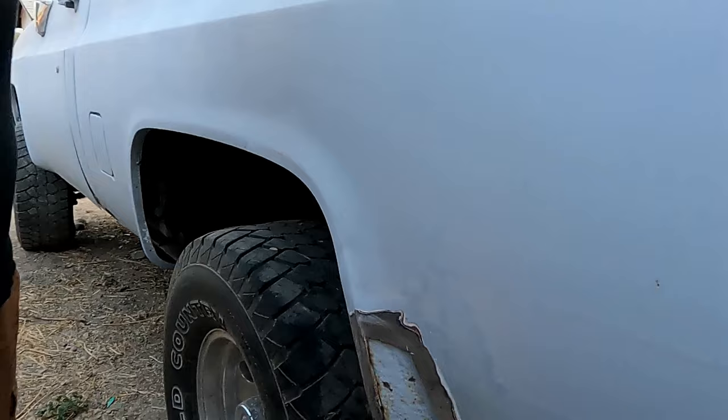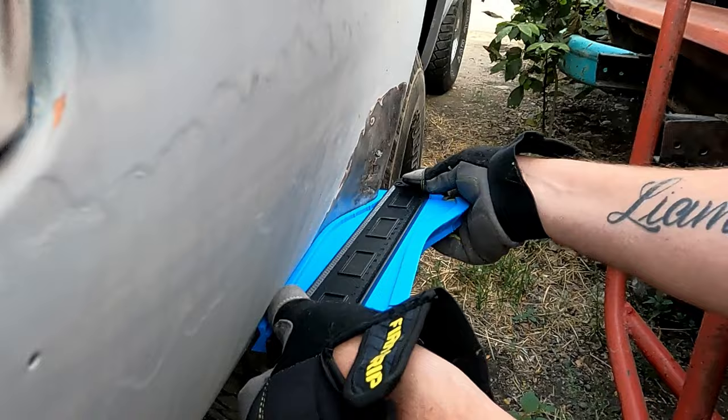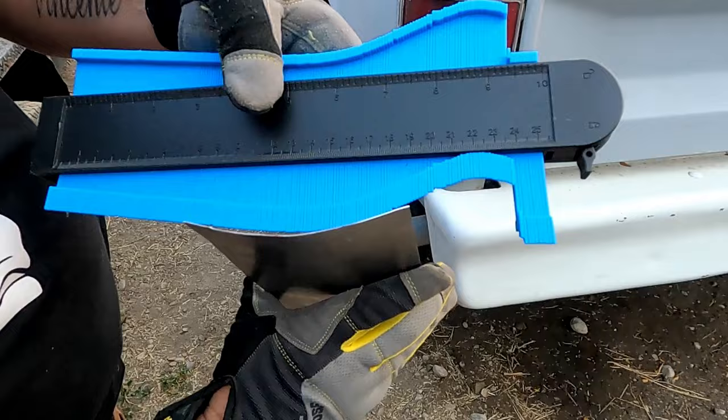What I'm doing here is trying to fabricate a patch panel for this side — you can see it's pretty rusty and torn up. I'm going to use a contour gauge to pull a contour from the other side of the truck to find out where my main patch is. I'll just get an idea where that's going to be, then flip it around, and I've got the contour there as you can see.